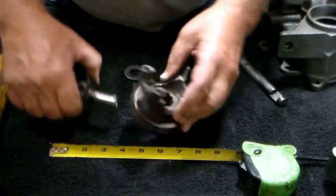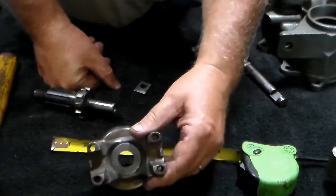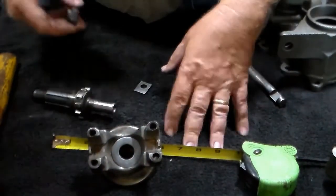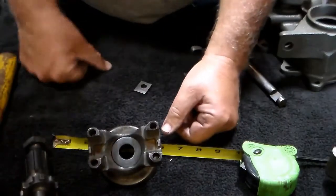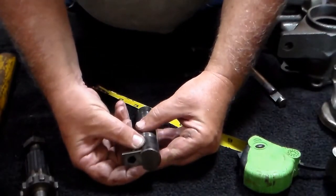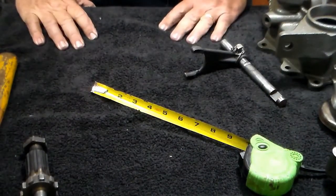We've got to clean them up inside here and make sure that they fit well. There should be this washer that fits inside here like so. A lot of people think when they get this companion flange that that's the way it's made, because that thing is glued in there with a ton of grease and old dirt — but no, that thing is going to pop out. You can clean it all out and get it back together. Onto the end of this shaft is going to be your nut, which will go through there once this is cleaned up. The last piece is going to be the intermediate shaft locking plate — it fits into the groove on the intermediate shaft, locking it into place, and bolts into the back of the transfer case. If you've got all these pieces, inspected them, and ordered replacements for what's needed, you're ready to assemble the Model 18 transfer case.